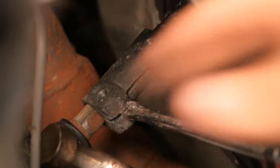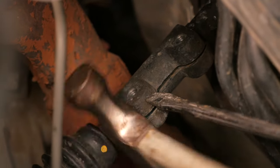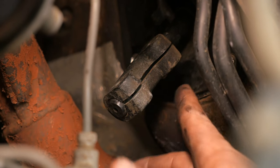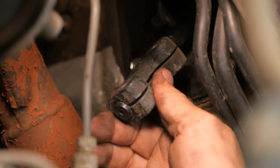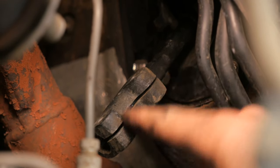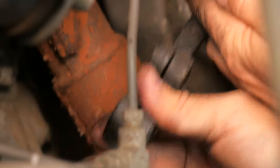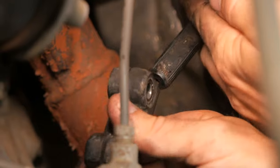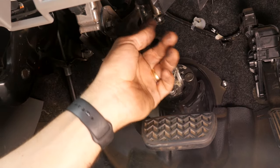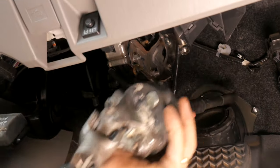Be careful of the brake line right here — it's pretty fragile, so don't get too wild. Once you get the lower shaft away, pull this sleeve off altogether. You may pop it right off the steering wheel at this point — the whole shaft may come out, but that's fine. You can see it already pulled off the splines up top, so now just pull it out.